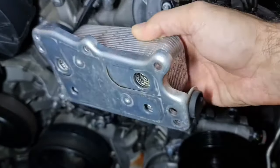To take off the seal, the easiest way is using one of these hooks, or otherwise you might want to use a tiny skinny screwdriver to go underneath and simply take it off. As you can see, this is worn, too flat and skinny to hold any fluid in there. So it's time to replace. Here we've got a brand new one, flexible, nice, and a lot of meat. It's guaranteed to keep the fluid in there for the next 10 years.